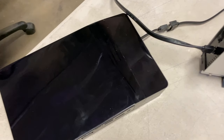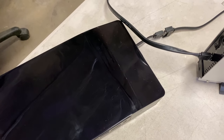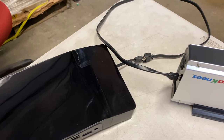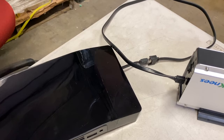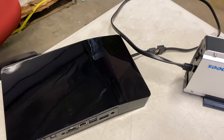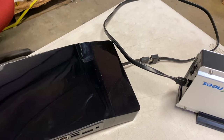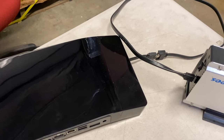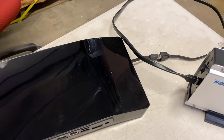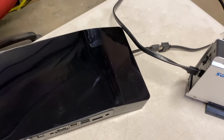We have videos of changing your drive with both an internal and external, so feel free to watch those to get an idea of the process. Let me be clear: we cannot guarantee that we can save your data ever, but we have been having a lot of success saving data on Bolts so far — far more than in previous TiVo models. We think our success rate is now about 80%, assuming that your unit failed with the four flashing lights shown earlier.